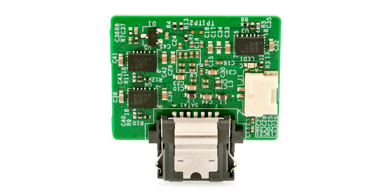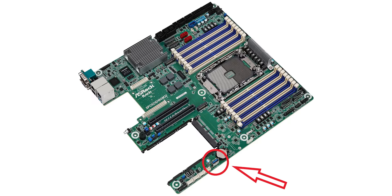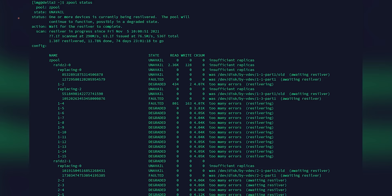These days you would be better off using a SATA DOM if you have the space available in your system and the budget. It serves the same function as a USB DOM but can read and write much faster. Or you could use an internal USB 3.0 header DOM or a normal drive and an internal Type-A port — something many modern server motherboards are actually equipped with now. It all depends on your tolerance for dealing with boot drive rebuilds. Linus and Jake have experienced multiple drive failures on their Unraid boxes over the years, including some of our servers here, and it's been a bit of a pain.